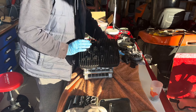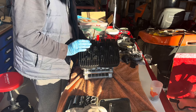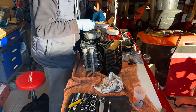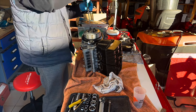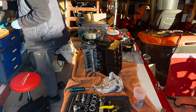What I'm going to do now is put the kickstarter mechanism in and start reassembling all of the clutch basket. Here I am diligently putting the clutch basket back in, and then at the end I realised that the kickstarter mechanism has to go in first. So I had to take off the clutch basket and start this bit all over again.